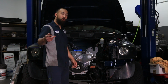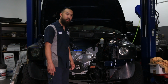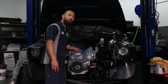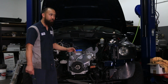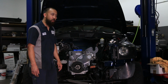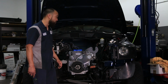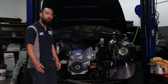And big shout out to Lenny and Brian and all the guys out at DDP. They reworked Betty's injectors with new nozzles that'll work with the wider bowl, the 124 spray angle. It's got the new DDP nozzles that should perform great. There's been good testing with Dustin Jackson's Pro Street Lightning, and they seem to work really well with his truck. So I don't see a reason why they won't work well for Betty. They're pretty much the same specs. They flow out the same.